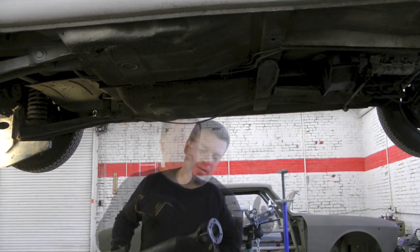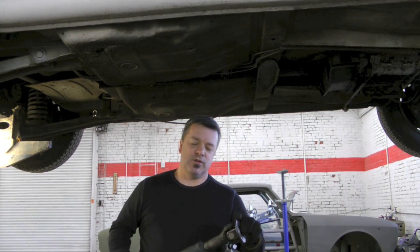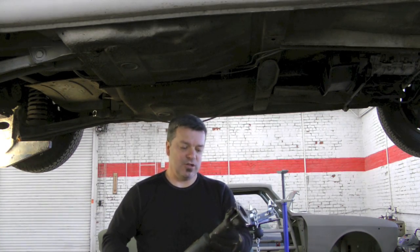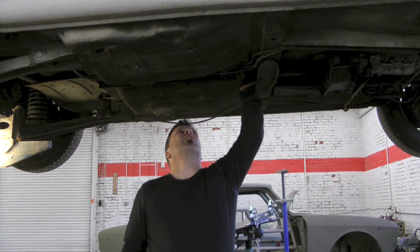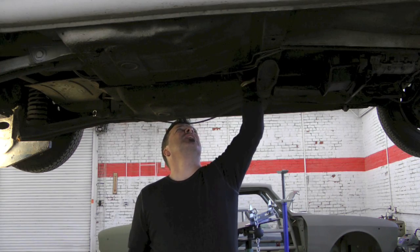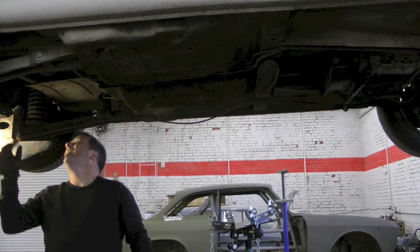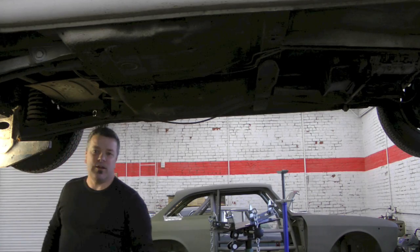Now I'm going to just put it back together. I use multiple marks so as not to be confused by scratches that might be on the driveshaft. This is my front section because that's where the expander shaft is — there are my multiple marks. And lo and behold, I did not put this one back in exactly where it was. This is why it's a good idea to mark them. There are my multi-marks for the other side. So I'll set that one up, and that's ready to go back together the way it was.